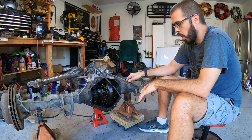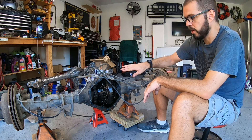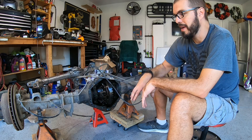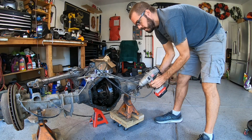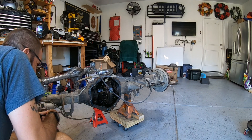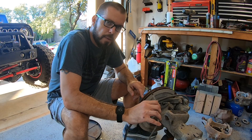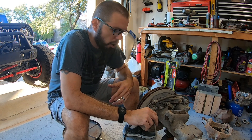After you're done with that, all these brake lines have got to go. There are a few bolts — there's one here, the diff cover has a couple that hold, there's one on the other shock mount — and then basically they're going to come right off. After you have those bolts out, these hard lines just get snipped. They're probably going to have a little bit of brake fluid in them, but no big deal — it won't be much, if at all.